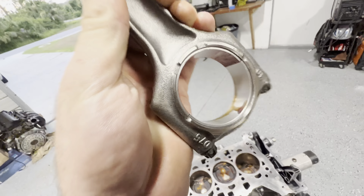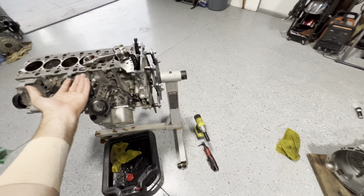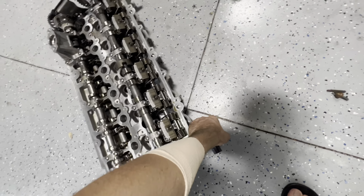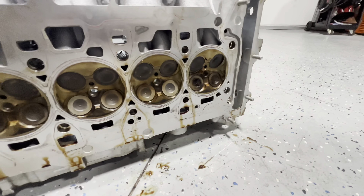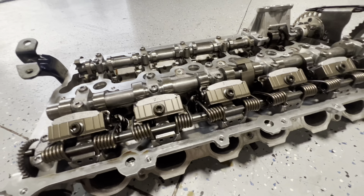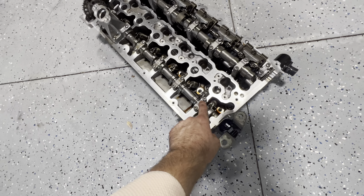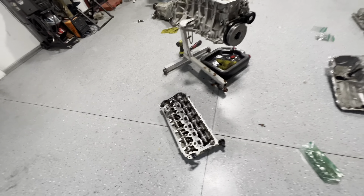The crank is in perfect condition, the bearings are in perfect condition. This motor was obviously beaten on, but it's rebuildable. As for the head — it's in good condition as well: no bent valves anywhere, it's actually pretty clean. I don't know how many miles are on this motor but it's probably not that high. I also took the cams out and the caps looked pretty clean — there wasn't any scoring, big scratches, or gouges.